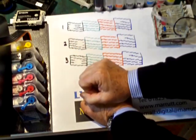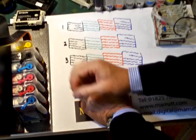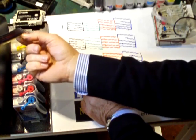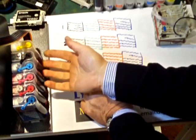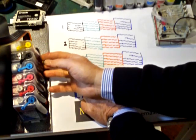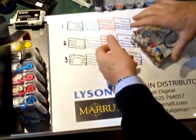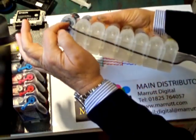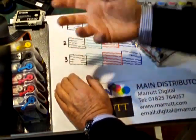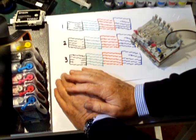Step three: make sure that your ink is travelling up the feeder tubes without any air gaps or bubbles. We've rigged this one up so you can see some bubbles in the line. If you see bubbles, either your reservoirs are partially empty, the tube connection at the base of your reservoir may be faulty, or the connector which joins the tube with the cartridge may be faulty. You may also have a problem with the seal underneath the reservoir — we'll show you how to check that by turning the system upside down shortly.